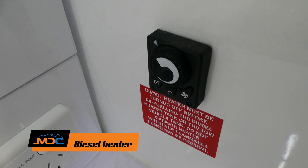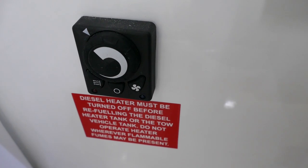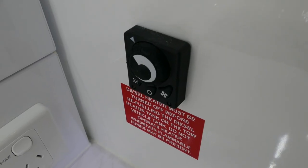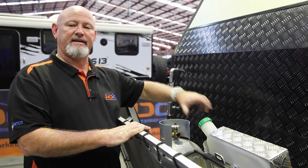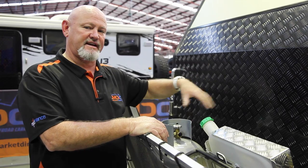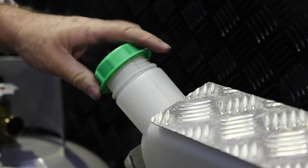In this particular model on the 16 Island, just beside the person who sleeps on the right-hand side is where you turn your diesel heater on. Basically, you've got to turn it on in your function box inside — your mains and so forth. You've got to turn the heater on and then just hit the center button. You've got to turn it up to full — make sure it builds up, you've got to let it build up. If you want to turn it down to the desired level, just the big knob at the top — you turn it down for fan-wise and how much heat you want to come in. Also, if your red light comes on in your diesel heater, that's: one, maybe you're out of diesel at the front, but two, it just hasn't lit, so you've just got to try it again. Give it about 20 seconds and then try it again. Your tank is at the front. If for some reason you've run out of diesel, please do not come out here while it's running and put more diesel in it. You have to let it shut down, let it wind down, then come in and pop more diesel in it, and then go back in and light it again. Please do not fill it up whilst it's running.